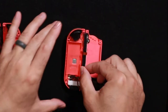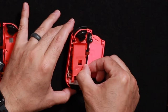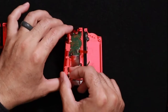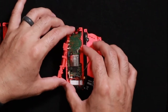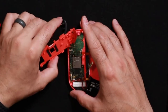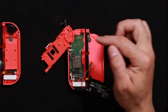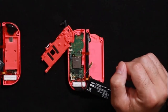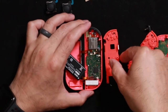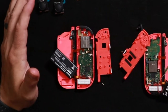That's all the screws to take off both of these. You're going to pull these plastic pieces off — be careful with the triggers, you may have one trigger fall off. These are going to flip the other direction. This one is a little bit tight on the ribbon, so you may have to twist it. If it does come out, it connects right back here. You're going to flip it over to the right-hand side, and you do have a little bit longer ribbon on this one, so no worries there.